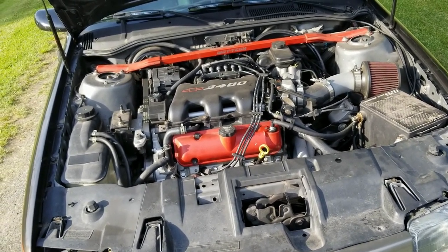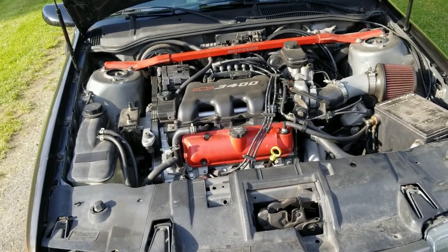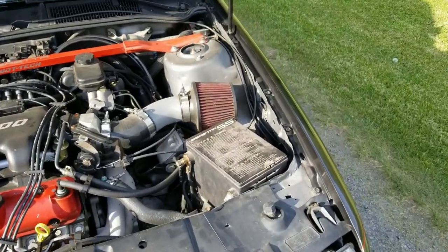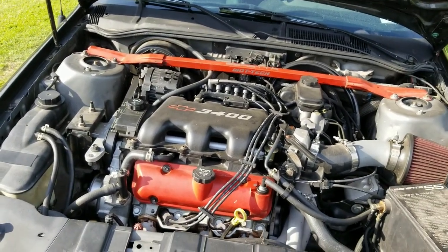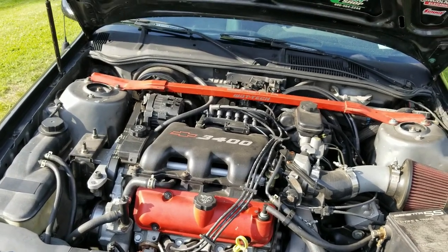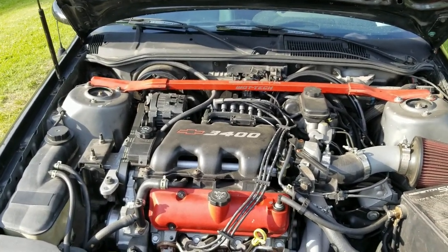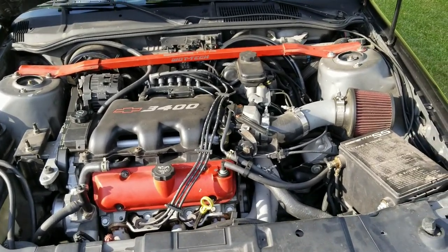That part of the tuning takes a little while to figure out but makes a huge difference once you do. I've got this thing dialed in like mint now — runs really good. I've actually burned chips for some buddies who bought from various places and the car still didn't run right. I can just burn a chip with AutoProm and send them off.